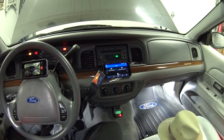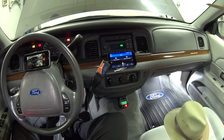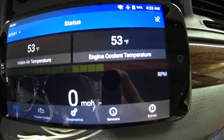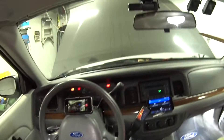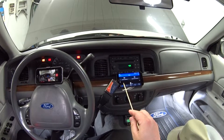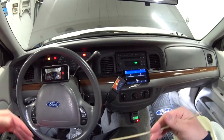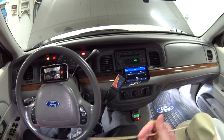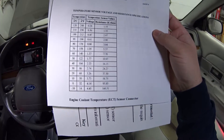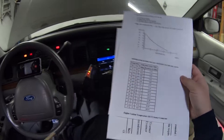My car has been sitting in the garage for the past 24 hours, so everything is stone cold. These are the readings — you can see the engine coolant temperature is 53 degrees Fahrenheit and the intake air temperature is 53 degrees Fahrenheit. That means it's cold soaked, meaning the engine is as cold as the air temperature in my garage. Now we have one part of the information we need to test the sensor. We have a temperature, so now we need to go out to the sensor and check the resistance.